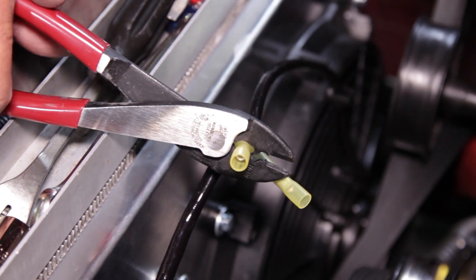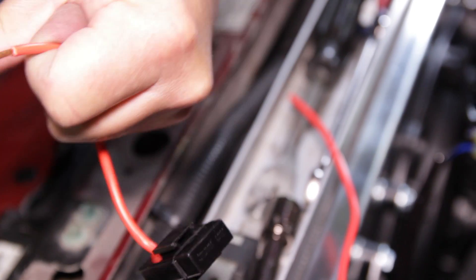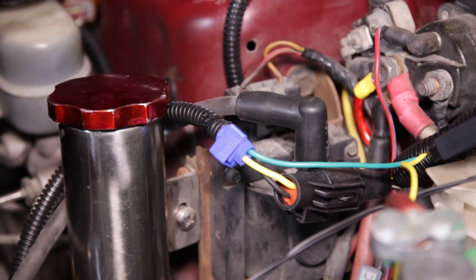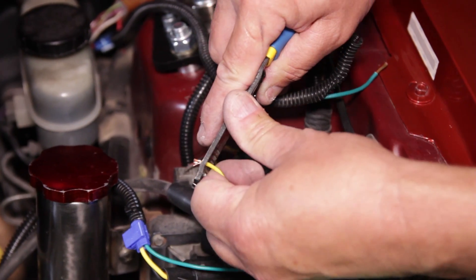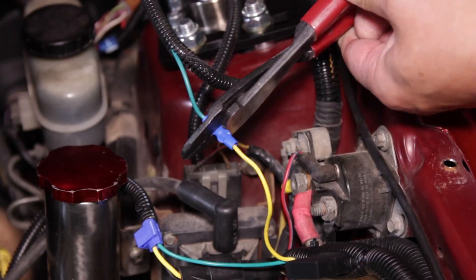The red wire from the controller will go with the black wire on the fans. The red wire from the solenoid — the 3-foot single wire included in the fan controller kit — will go with the blue wire on the fans. Use the included quick crimp to splice the green wire from the controller to the yellow AC wire. Quick crimp the yellow wire from the controller to the 12-volt ignition source on the main harness leading to the firewall or from the fuse box inside the car.